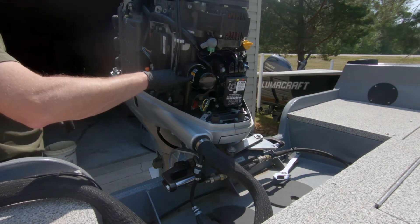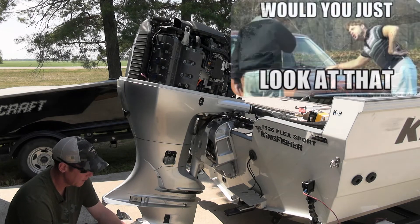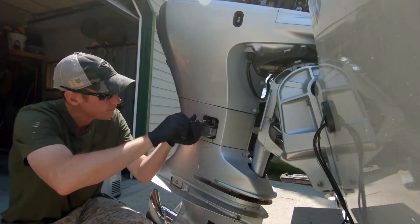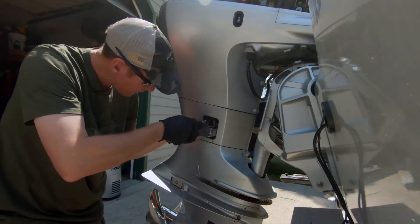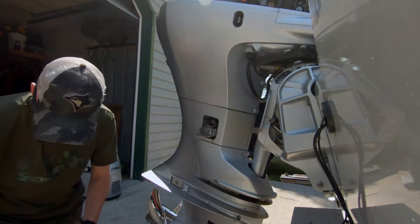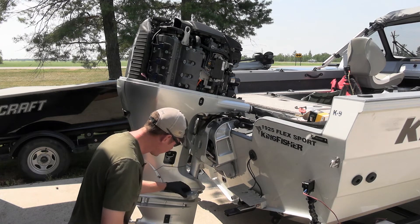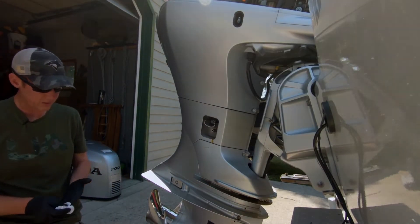The majority of the messy stuff is over. Before you put your drain plug back in, take a look at it and make sure there's no shavings on it — just wipe off the oil and put it back in, making sure it's tight. Wipe up the area a little bit and let any remaining oil sit and drain.